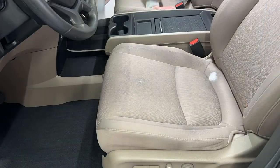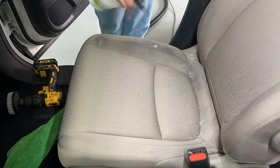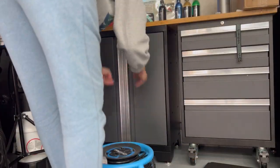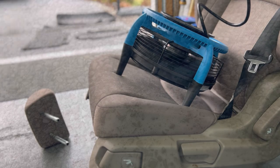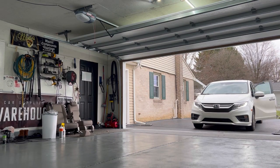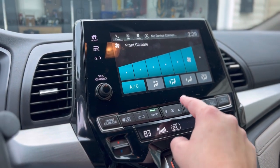Because we had all-weather mats, we didn't have to extract any of our mats, and our carpets cleaned up really nicely during our vacuum step. For carpets with heavy soiling, you would do the same process: spray with your cleaner, agitate with your drill brush, extract, and then let blow dry. For detailers looking for a really great blower, this is the DryPod from DryEase — my favorite blower that will accelerate dry time by hours. These seats weren't very dirty, but we had enough spots that I didn't want an inconsistent appearance, so we extracted. Now we're going to turn the vehicle on and turn our heat on full blast.